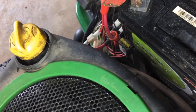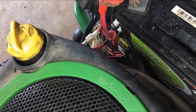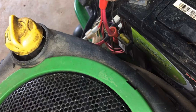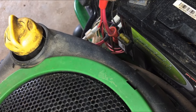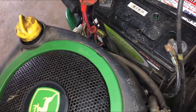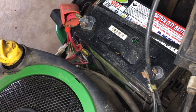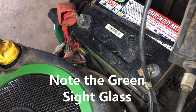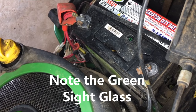The hour meter won't come up. I've tested that fuse and it's okay, and the hour meter still comes on, so I know that fuse is okay. I've also been through and cleaned off my battery terminals - took them off and cleaned them up, and once I did that it started making a bit of a clicking sound.